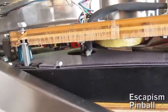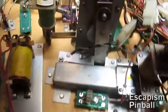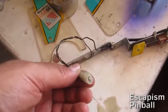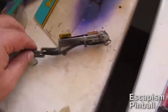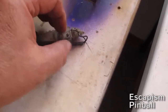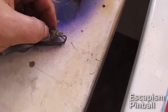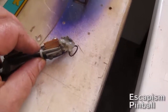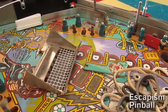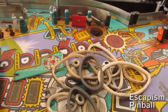There's the main playfield and the mounting holes have been crushed by the screws there. This is the goalie target — spring loaded, so you don't break it when you hit it while it's moving. It's also got a switch connector. The switch itself has come loose and the wires have broken off and it's been patched with some hot glue, mainly to stop vibration, but it didn't do much for the connectivity. So that'll be cleaned up and fixed and a new goalie plate with a goalie decal fixed to the front of that, so it doesn't look like a switch — it has a little plastic goalie marking the goal.